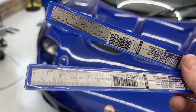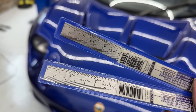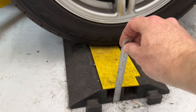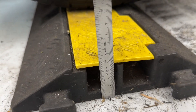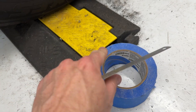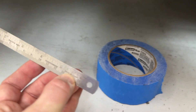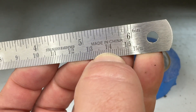I got these on Amazon — a little two-pack of stainless steel rulers in millimeters — and I'll be using these for a lot of my measurements; link in the description below. Because my wheels are already on and raised up a little, I have to subtract the lift height from the measurement to the side rail — that's about 44 millimeters. Measuring through, it comes out to exactly 140 millimeters.